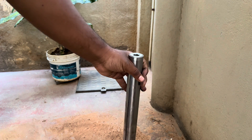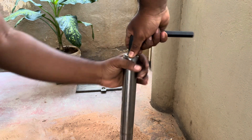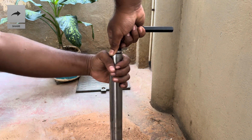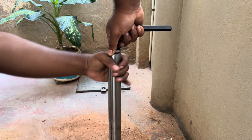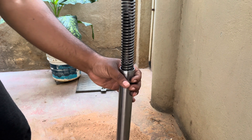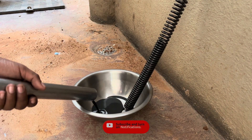Now as the fork is out, start removing its top nut completely using the 11mm Allen key. Make sure that you give enough pressure on it to avoid the nut from shooting away due to the tension in its spring — do this process slowly and carefully. Once the nut is out, take out the spring and keep it on a clean pan and let it drain for some time. Also drain all the old fork oil out by stroking the fork tube a couple of times.